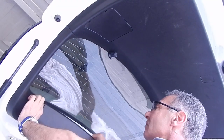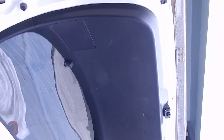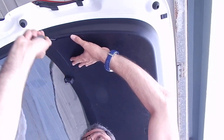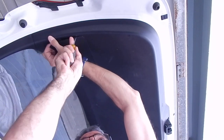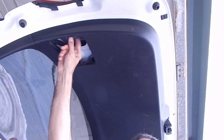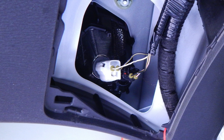Here I'm removing the back panel surround on the back hatch so I can get access to all the wires. This panel is where the reverse lights are — they're actually on the door itself — so I had to take the long route to get to those wires. You need the power lead to attach from the control unit to the power lead on your backup light. The little white wire there is the power, and the black is the ground.